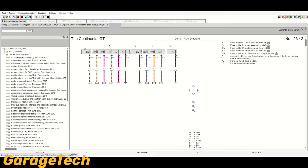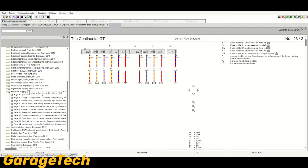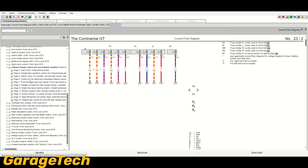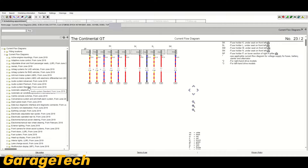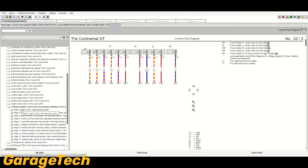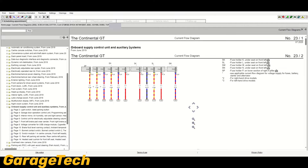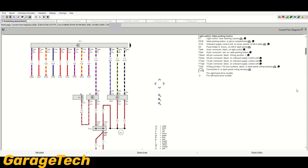Over on the left-hand side you've got your different wiring diagrams. There's not one whole big wiring diagram for the whole vehicle — it's split into individual little areas. For Volkswagens, they tend to use one called basic equipment, which covers things like your horn, wipers, indicators, light switch, etc. — basically everything the car comes with as standard. Anything else is an additional wiring diagram. I'm currently looking at a Bentley Continental GT, at the onboard power supply control unit. At the top it gives the name, and at the side you have the wiring diagram number and page number, which continues as you scroll down.